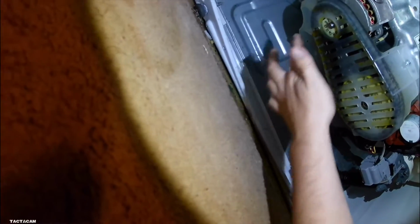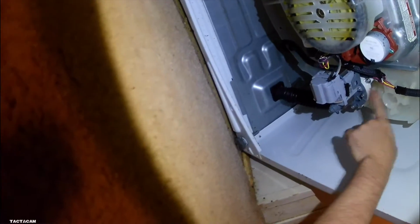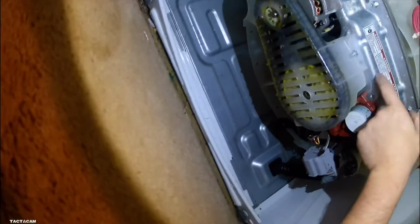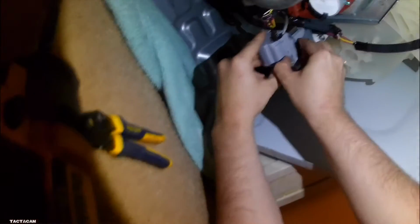This one also has an oil leak. Customer's not gonna do anything with that because those gear cases are pretty pricey. But if this drain pump only has like a sock or something in it, it'll definitely be worth it for them. It'll at least buy them some time until that gear case truly goes out.